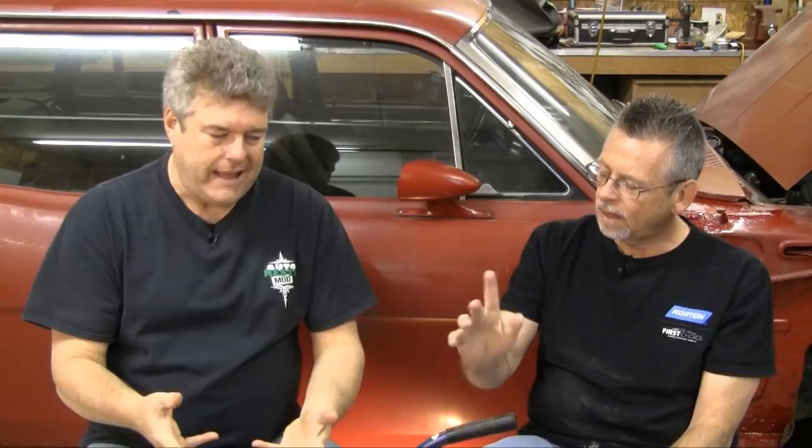So Larry, what do you think about the different methods of blasting? Well, before we get into different methods of blasting and paint stripping in general, everybody needs to understand not every vehicle needs to be stripped. We've actually determined that about 65–70% of this wagon doesn't need to be stripped. If a vehicle, new or old, has a really good sound foundation to begin with, don't strip it.